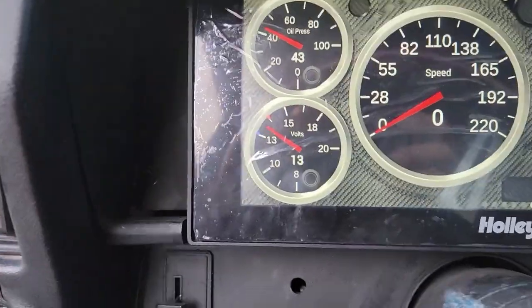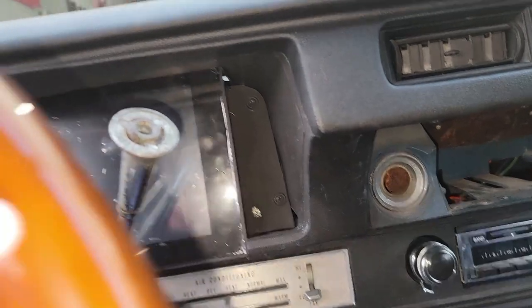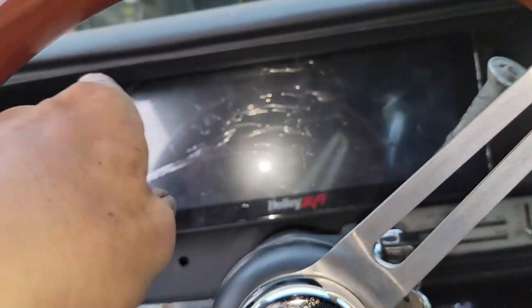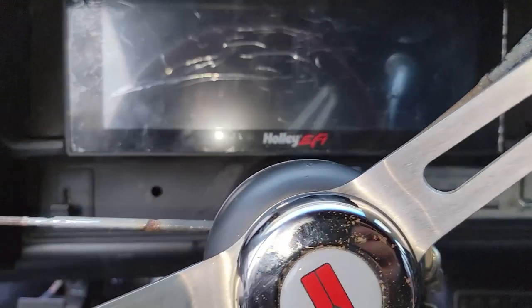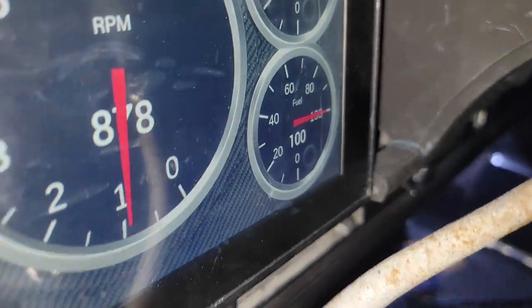It's done. I made a panel to fit in there — it looks a little grimy up close because I touched it rushing to get out of here, so I'm going to touch up the paint. I notched out the dashboard on both sides, cut a groove in the top so the top of the dashboard is flush with the top where the screen section is. It sits just off the steering column. Oh — fuel level, I still have to add that, so it's gotta come back out. Got the music going, finished it off — fuel level is now on it.